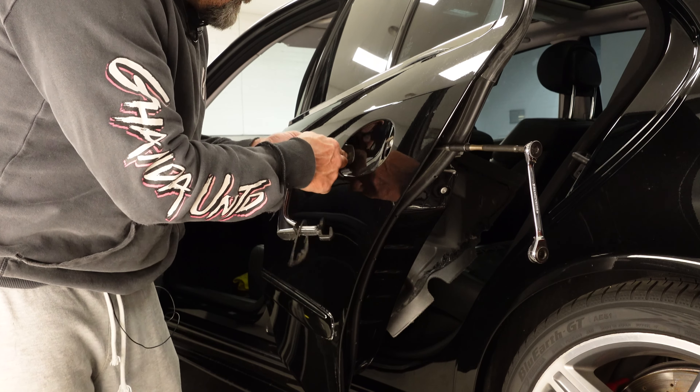Now this will come a little bit loose over time. The rubber seals around the quarter glass window do get a little bit sticky over time, so you'll just need to give it a wiggle to release it. This window trim seal here - just remove that so that we can get to the rubber channel and just slide it straight up and pull out as well. We'll just flip that over there for the meantime.